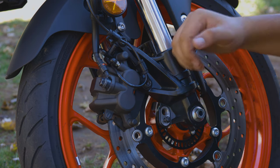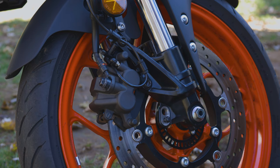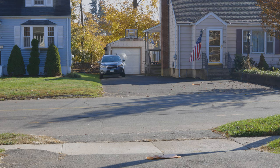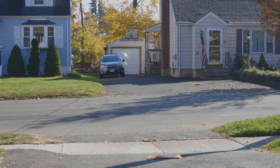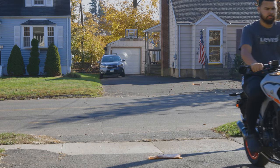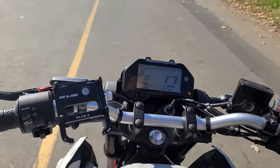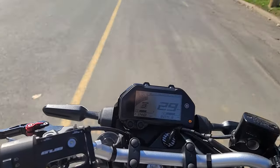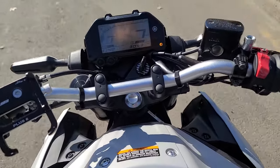Just be careful — it could be dangerous. That's all there is to it: remove the sensor, zip tie it here, and you're done. If you ever want ABS back, just put it back where it was, turn your bike off and back on, and it'll start working again. That's how you disable ABS — thanks for watching, I appreciate the love, and I'll see you guys later. Peace.